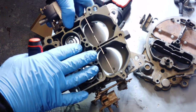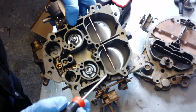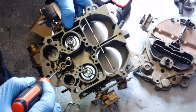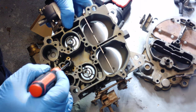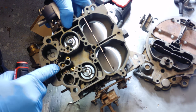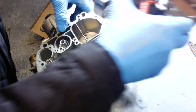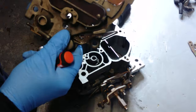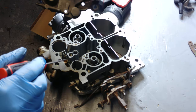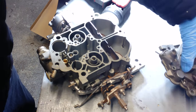In the next video I'm going to go into it more thoroughly when I take it apart and clean it. You have your jets here, your secondary, your metering and power valve, and your needle and seat. I'll show you a few items in there and how you can tune it and make it adjustable. This one actually had it modified already — it was knocked out and tapped to put in an adjustable screw so you can tune it.